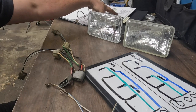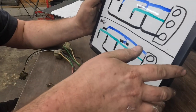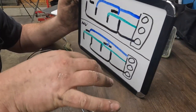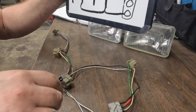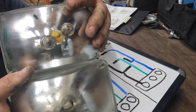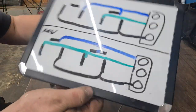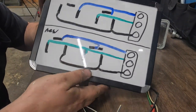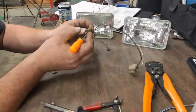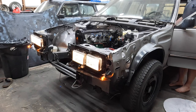Based on a cursory glance at the drawings, the high beams and low beams are fed by the same switches and fuses, so the low beam circuit should be more than capable of handling two lights. If it's not, it'll let the smoke out pretty immediately and we'll know. Here's the little headlight sub-harness — on a high-low beam you have three prongs, on just a high beam you've got two. On these, the middle one is your high beam and these are the low beams. This is what they are now, and this is what I'm going to make them. Let's see — light, light, and light. Lovely!